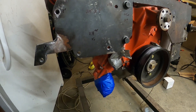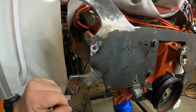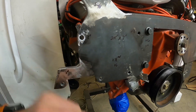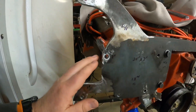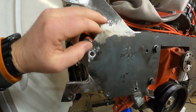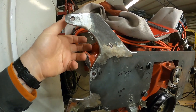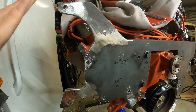This one is 2 inches down from the top edge, up here for the alternator bracket. I didn't even measure how far in it is — I eyeballed it, maybe about a half inch in to the center of the bolt hole. I just had the alternator hanging up there, saw where it was hitting, and took that spot off. The other bracket up here is 3-5/8 inches tall coming off the top edge. I held the alternator where I wanted it, tightened down the bolt, built a cardboard template, cut it out of steel, and welded it on.